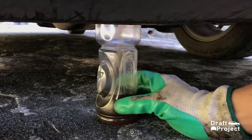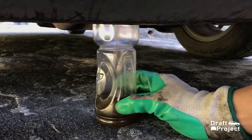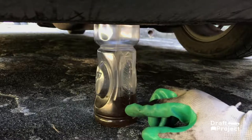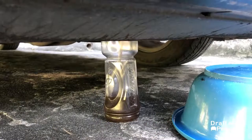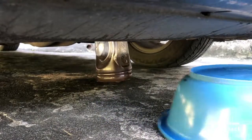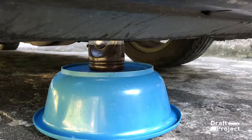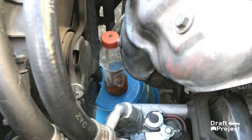Make sure that the tube or hose is submerged into the brake fluid. The concept of this method is that when you release the pedal, the system will suck fluid instead of air — that is the reason why the hose should be submerged into the fluid. This method is sufficient and a cleaner way to bleed the system, making bleeding faster and a lot easier.